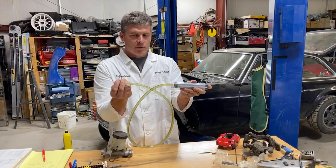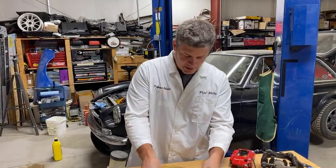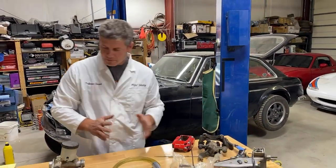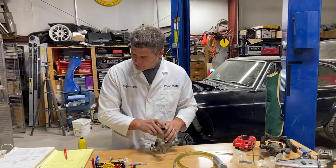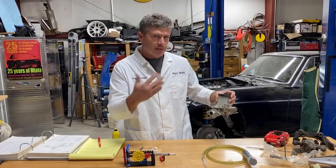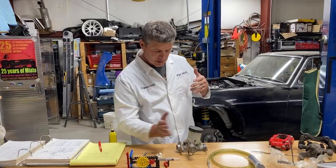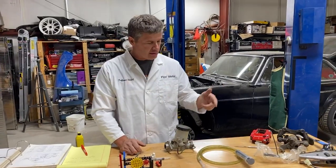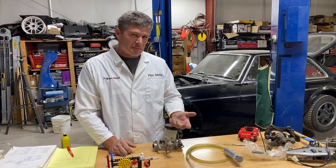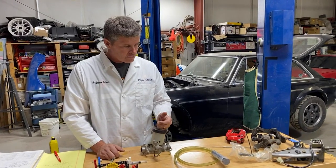You can't see it going very far in this demo, but trust me it is moving. That is simple green, not real brake fluid — so if there's a spill, don't fear. You can actually take all of these ratios and figure out how much pressure there's going to be on the pads based on how much pressure you put on the pedals, given the sizes of everything. I should talk about the actual ratio on these things.